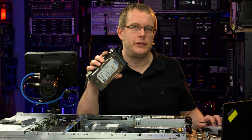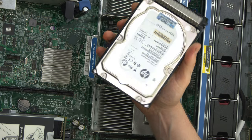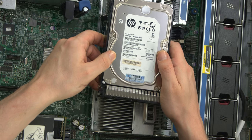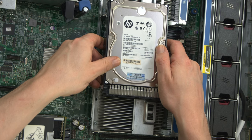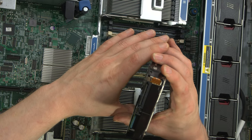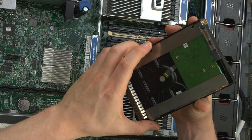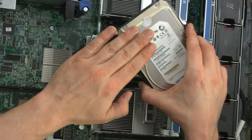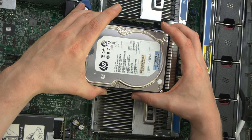There's one more point about software RAID — an advantage I didn't mention. These are four-terabyte SAS drives, and even on the used market they can get pretty expensive. I don't really need the performance of SAS drives. These are only single-channel drives, so they don't actually need to be SAS. In fact, if one of these drives fails, I don't want to have to replace it with a SAS drive.